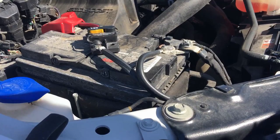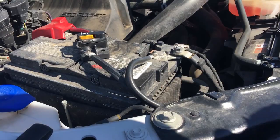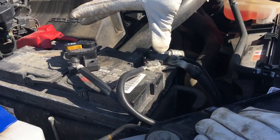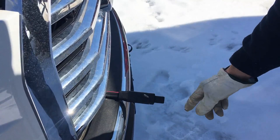We will be jump-starting a vehicle and operating a grain trailer. This is a service truck power kit made by Sherco. It has four gauge wire and it attaches to the positive and negative posts on the battery. It's protected with a 120 amp reset breaker. You attach the wires, run them along, hide them along the line of the trailer and bring it up to the front, where it's permanently fixed.